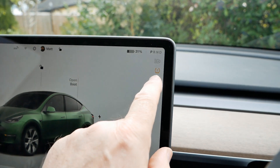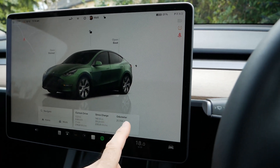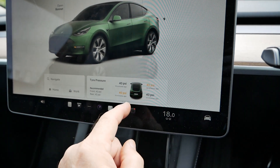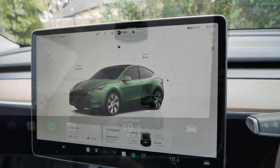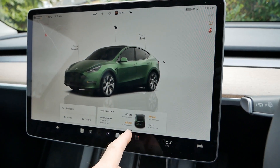When I got in my car this morning I had that symbol come up. On this car the tyres should be at 42 psi. Looking now they're all at 40 psi because I've just driven about 10 miles. However, when I got in this morning they were all at 38 psi — so they were all 4 psi under pressure — because it was cold overnight and it's now 12 degrees.